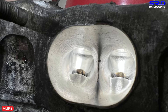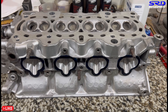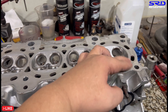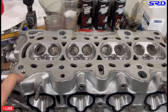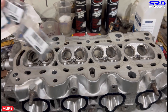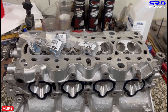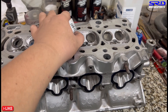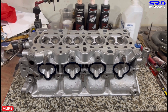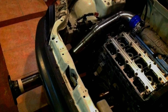The transition from the bowl to the port sidewall to the exit is really good — the curve is just perfect. The head is waiting because Raf messaged saying they're going to send Ferrea valves. We can't plug it since they're running the B16, so we'll thread it up and prepare the dowels. We're waiting for Raf to send the Ferrea valves and the block's valve train, then we'll assemble it completely. If you want to see the video of us finishing it up with the conversion, click to watch it.